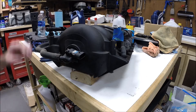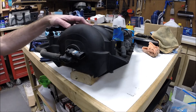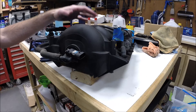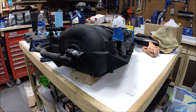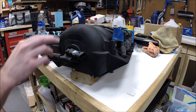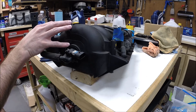I've got the intake manifold taken off. I'll point out that this is the LS6 intake manifold. Since my car is a 2001, typically from '01 and up even the LS1 got the LS6 intake manifold, which was worth a little bit of horsepower. Now we're looking at the back of the intake manifold - there are a couple of things back here that you'll need to disconnect, and sometimes it's easier to see it from this angle.